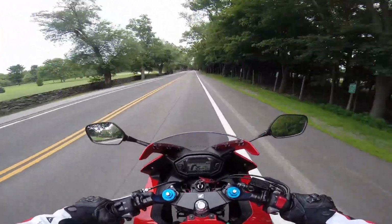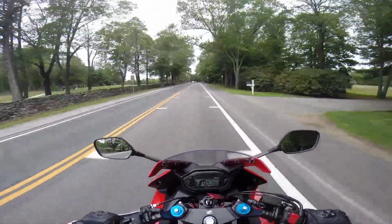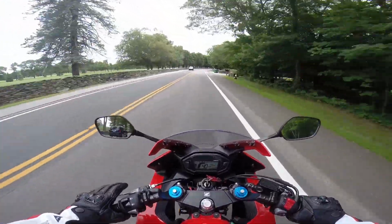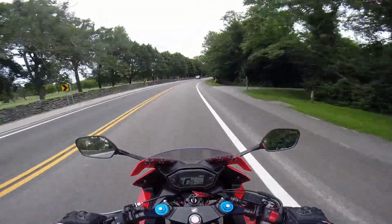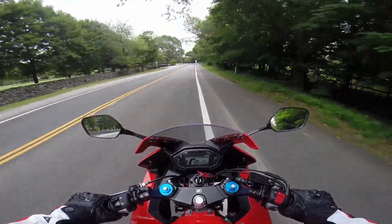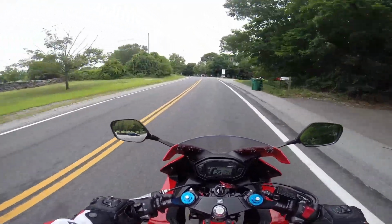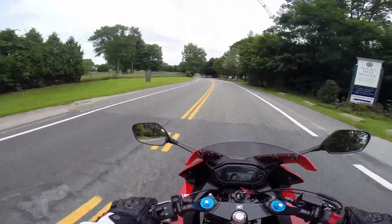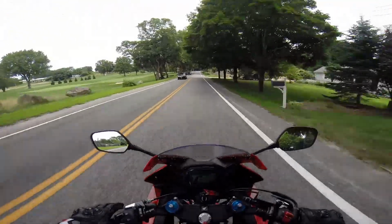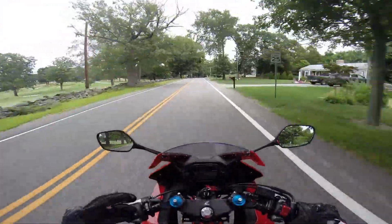Okay, so to downshift a motorcycle, I'm going to give a very basic example right now. Let's say you're coming up to somewhere you want to come to a stop. Now, if you only use the brake, let's say you're in 4th gear, and you just pull on the clutch and only use the brake, and then you get to a complete stop, you're going to be shifting down. You're going to have a problem shifting down sometimes because the gears aren't going to line up correctly.